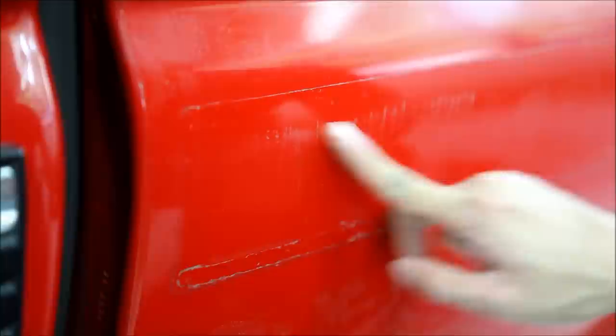Let me show you guys the scratches we're talking about — I'll do a super close-up here. You see those? Those are basically from the dirt rubbing with the fishing line and dirt rubbing up and down behind that molding. They'll come out — don't freak out. The top and bottom lines are the actual residue left over from the two-sided tape behind the molding. Anthony's going to rub that out with our paint clarifying compound, which is almost like liquid sandpaper — very high grit and it'll buff those scratches right out.